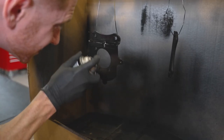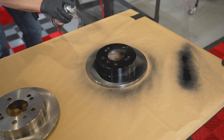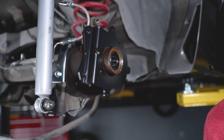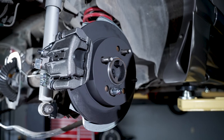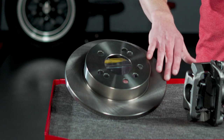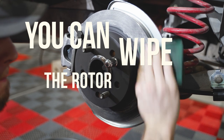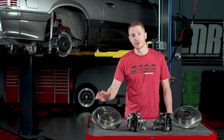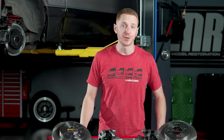While installing the parts, you do have the option to paint the caliper adapter brackets and the rotor hat. We went ahead and did this to ours, and it really completes the overall look of the install. Now if you do paint the rotor hats, have a little common sense here — you can mask off the rotor surface, or do your best to minimize the amount of overspray on the braking surface. For reference, brand new OEM rotors for newer vehicles have overspray on the braking surface, which is quickly removed once the brakes are applied.